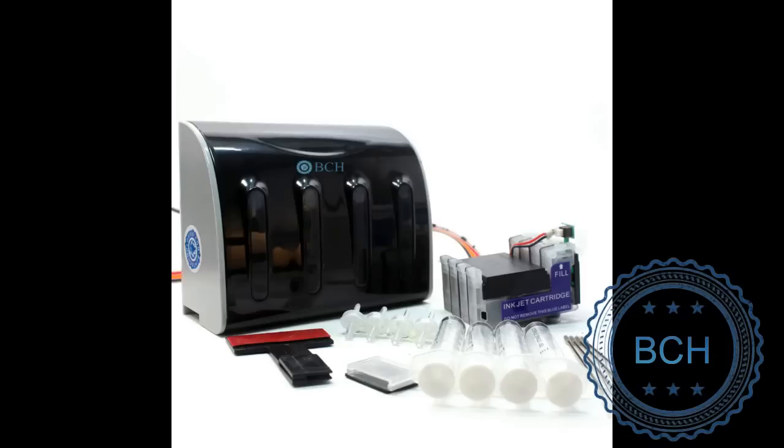The reset is triggered when the printer encounters an ink depletion error. If the printer doesn't encounter the error, the ink level will not be reset. For example, if you see the ink level is low and try to reset it, the cartridge won't reset because the low ink is a warning, not an error. You need to keep printing until the printer encounters the error.